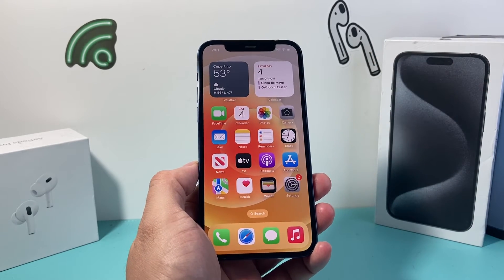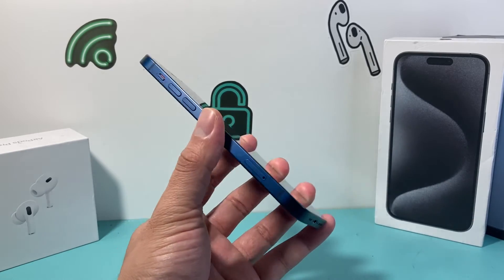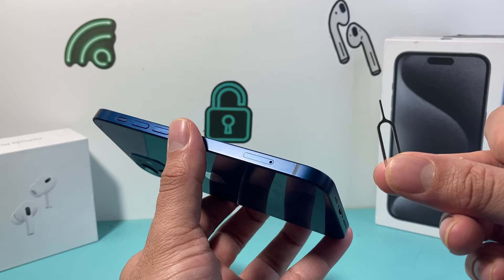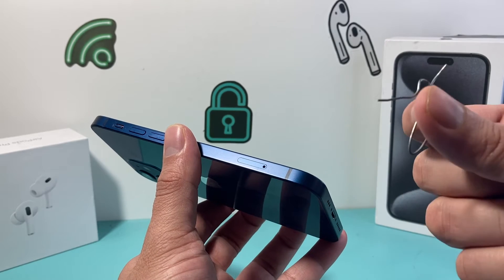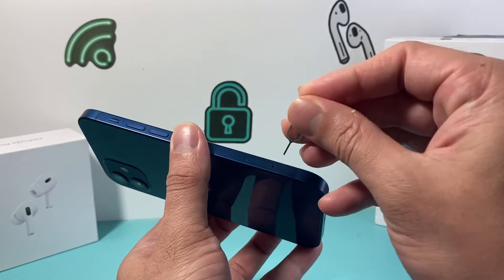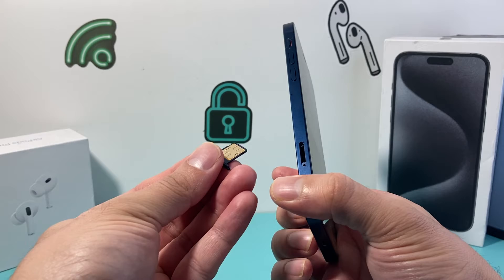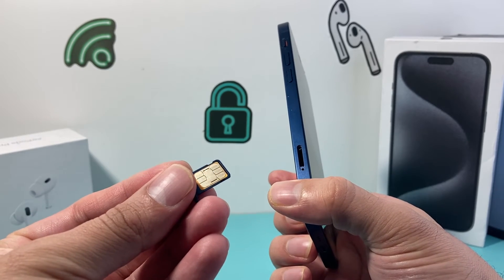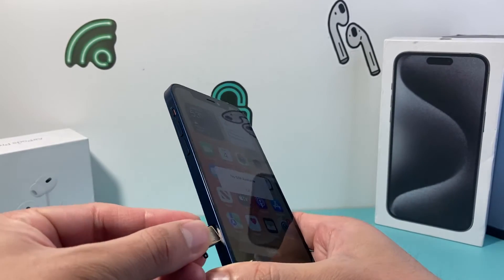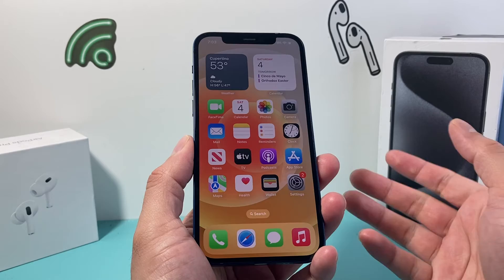If there's no update, or if you updated it and it's still not working, the next thing to do is — if your phone has a physical SIM card — take the SIM card out and reinsert it. The SIM card tray is usually on the left-hand or right-hand side. Locate the small pinhole and use a SIM ejector tool, or a paperclip, earring, or anything that can fit in there to pop out the SIM card tray. Take it all the way out to verify it's sitting correctly, and inspect that it's not damaged. Sometimes the SIM card can get damaged if there's liquid or water that gets into it. Then go ahead and put it right back in, and hopefully it reinitializes and your phone is working.